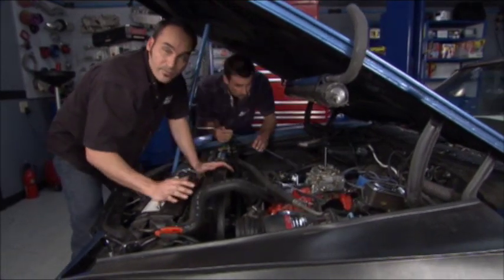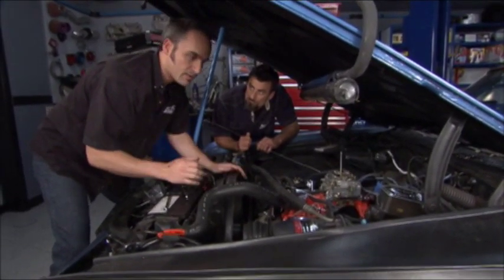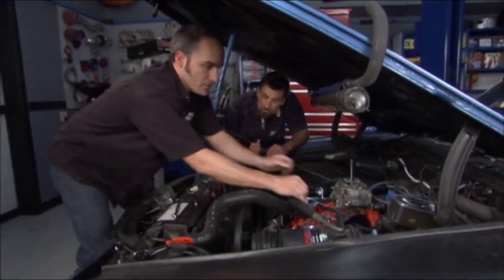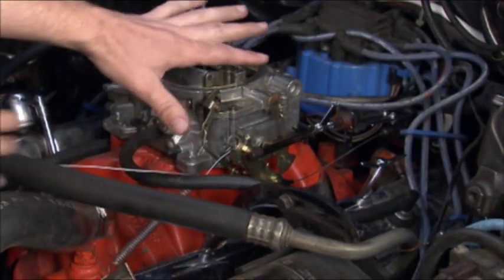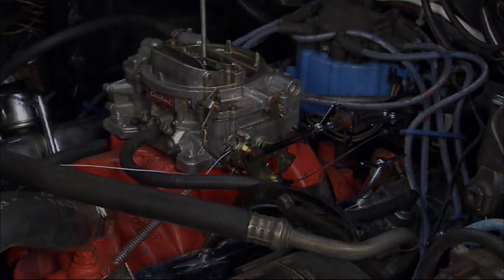You're gonna get in the car, do a full throttle while you're sitting there, and that should get your basic first settings. Now you can go for a drive, and on that drive you can see if you want the shifts to be a little bit harder, a little bit softer, a little bit later. If you need a little bit harder, later shifts, pull the tension on the cable — it's self-adjusting, should be good to go. A little bit softer, let some of that tension out.